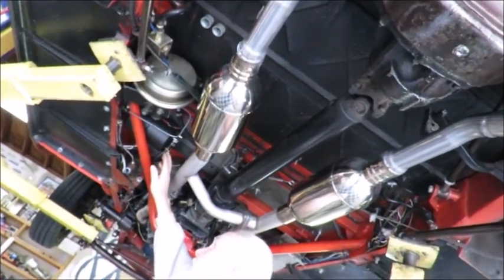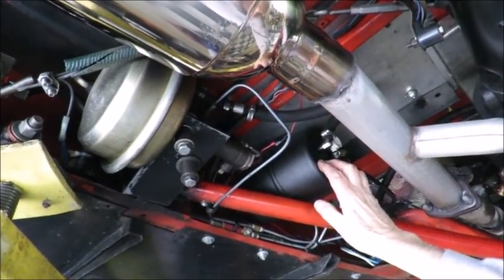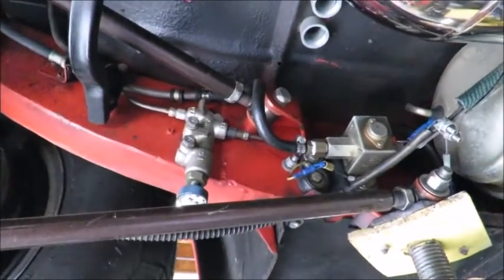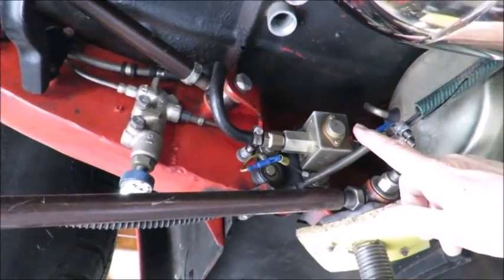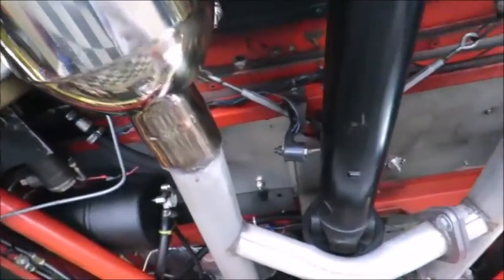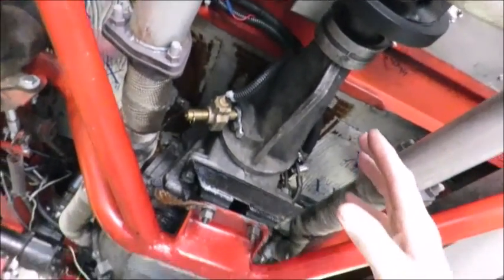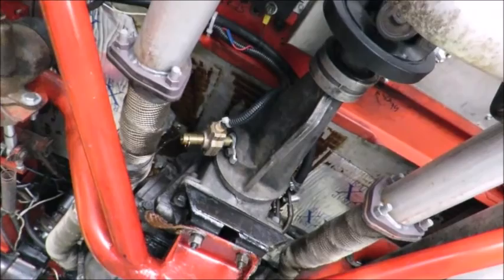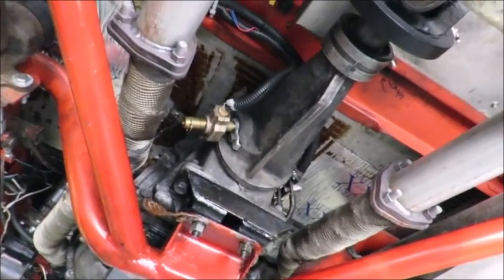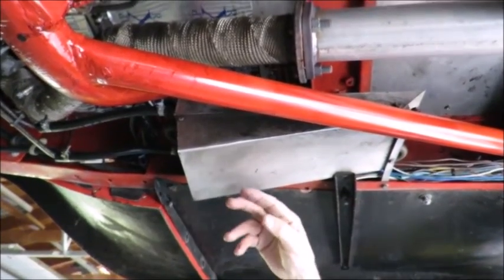It has a vacuum tank, it has a mild cam in the 302 Ford engine, power brakes, proportioning valve setup, disc brakes in the front. It has an electric fuel pump in here. The access to all the things in the transmission are right at the bottom down here. Nothing's enclosed, so pretty easy access. Right. The transmission is a C4. It has the cooler unit right here that cools the transmission, not hooked up to the radiator type, so it's more efficient.